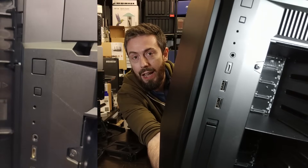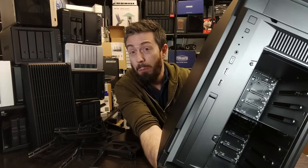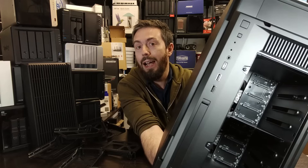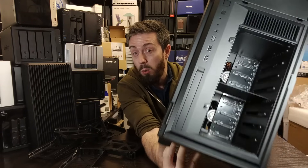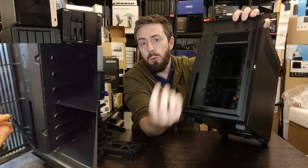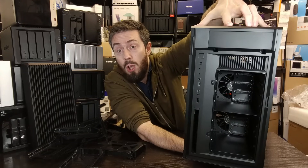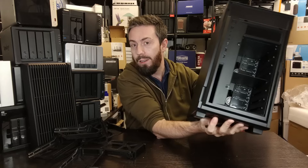On the front panel, we now have USB Type-C. You will be dependent on your motherboard of choice for the level of support, but from what I can see those are USB 3.2 Gen 1 connectors — 5 Gbps — but at least they've modernized things significantly by adding those LED panels and improved connectivity. Also at the base, there's a small 9.5mm optical drive bay where you can slot in a laptop CD drive and not have to waste the big chunky 5.25-inch bay if you want optical media on this device.